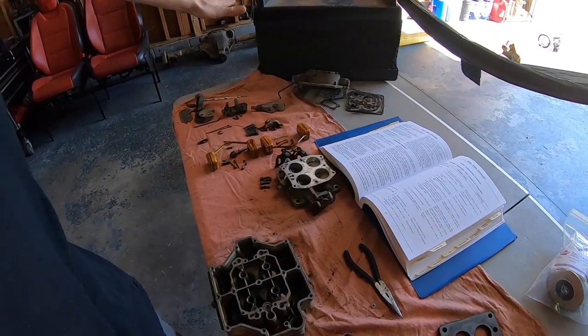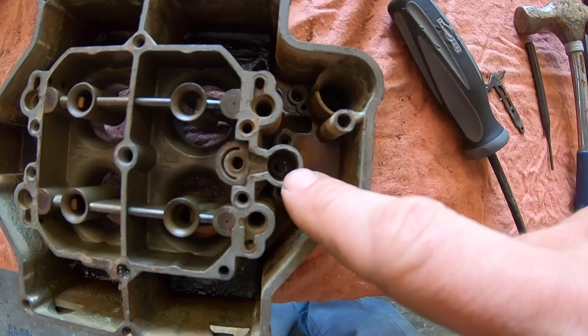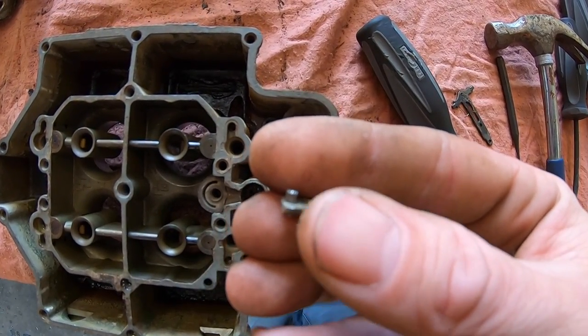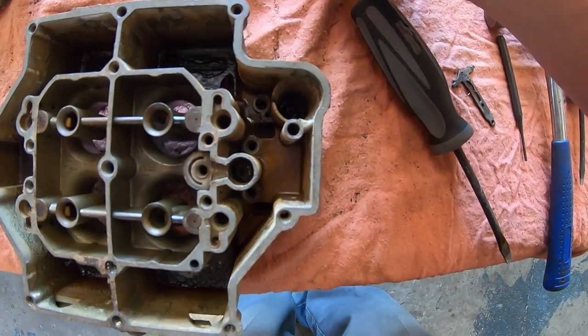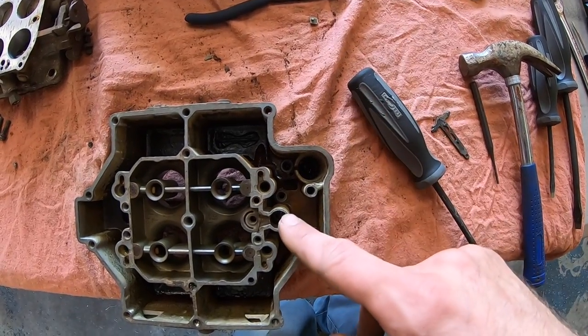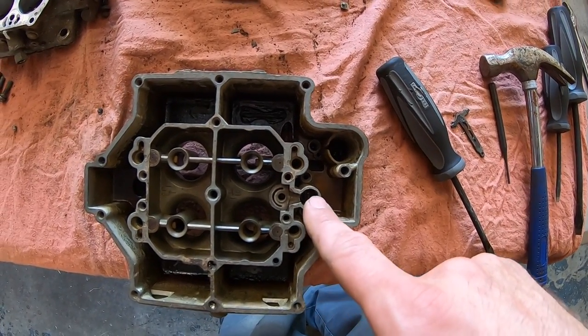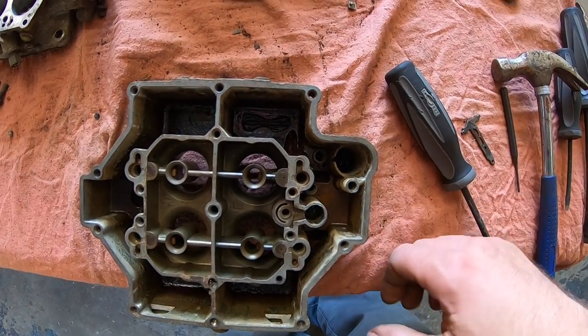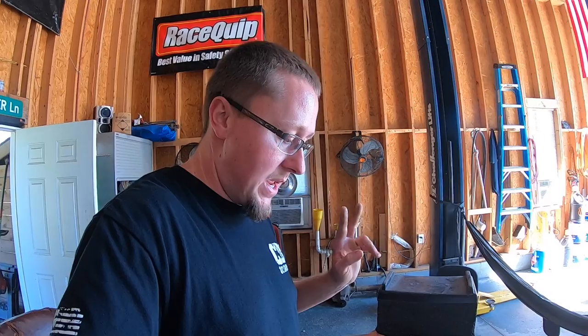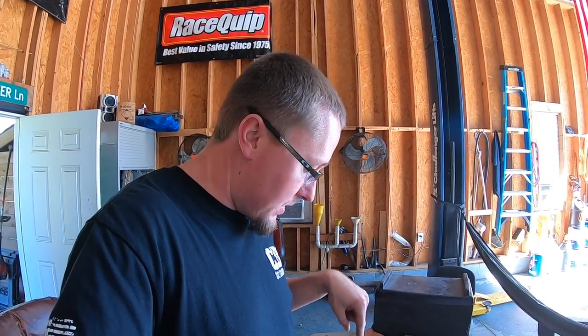Alright, I've got most everything disassembled and laid across the table but I've run into an issue. There is a plunger in there with a spring under it for the accelerator pump, and when I was trying to pull it out I broke a piece off of it — which is no bueno. I tried blowing air from the back side but when that tab broke off it's not airtight anymore. I'm going to get a little brush and ream the hole out to see if I can get that plunger to move more freely. This is what happens when you work on 65-year-old stuff. I'm going to go to AutoZone, get a bucket, fill it with lacquer thinner, and soak a lot of this stuff because scrubbing with brake cleaner isn't going to be enough. It needs to soak for a couple hours — so this might be a two-day project.